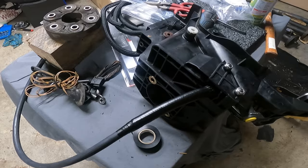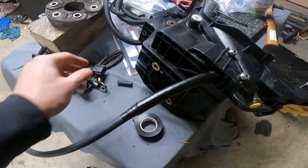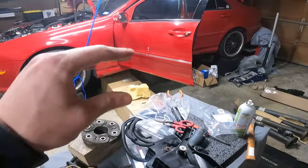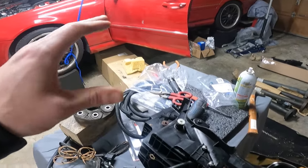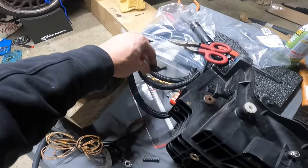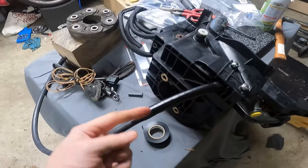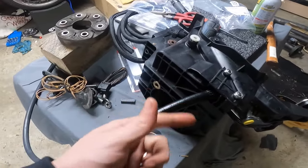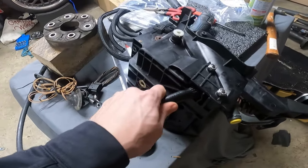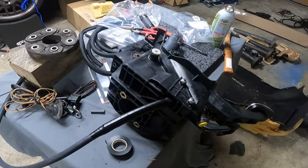All right, guys, well, scratch the gator grip grommet idea. The hole is too small, this doesn't bend correctly, so I got no grommets, guys, and I'm getting these pedals in there. Luckily that hole is pretty curved, it's very smooth, so I'm not really worried about it chafing. But just to be sure, I basically did two layers of this little nylon braided wire wrap, so one layer of that, and then electric tape, and then another layer of it, and another layer of electric tape. So I don't think it's gonna be any issues. This will still fit through there fine. So now we should be good. I'm gonna go ahead and get this installed, move on.